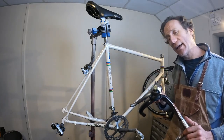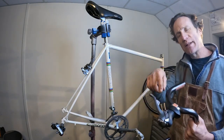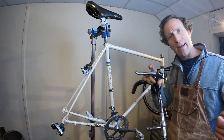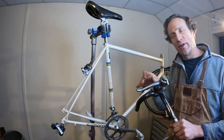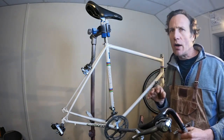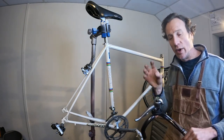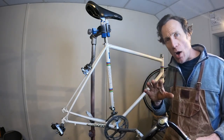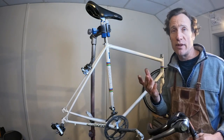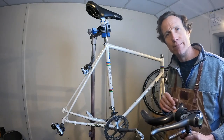However, I did read about a hack: if you leave the cable in there and pull on it, you can absolutely bathe it with spray oil from behind, get it right in there, and then work it backwards and forwards on the levers, clicking it through time and time again, oiling and oiling, and that can sometimes solve the problem. It's basically really old grease caked on and getting in the way. Now, I've done that. Whether it works or not, I don't know. Not going to find out until it's all built up. But if that doesn't work, I'm just going to have to buy another one. Obviously not new, but try and get one in as good a condition as possible. But we'll see what happens a little later.